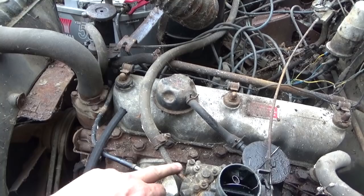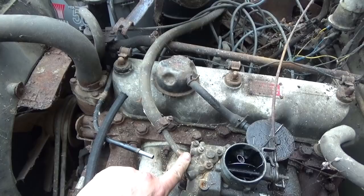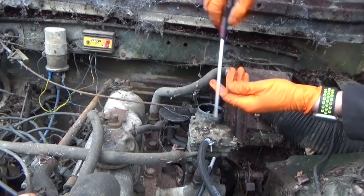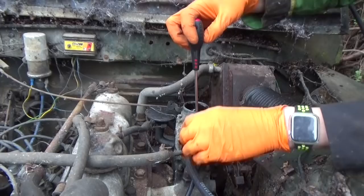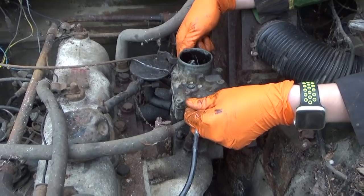Right, now let's try and stick a separate fuel supply on this, so I'll get a can and a fuel bulb in between two pieces of line so we can at least feed some fuel into this carb. It might then prolong it running. You're adamant you want to take this carb apart — you've got an obsession with taking carbs apart. It's just fixing things properly — something you could learn. Look at the old fuel — luminescent, nice color. All right, is that loose? Yeah, it's loose.